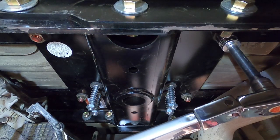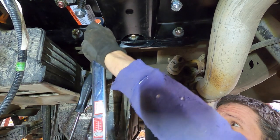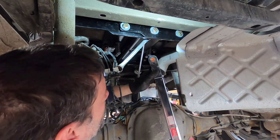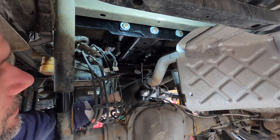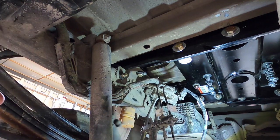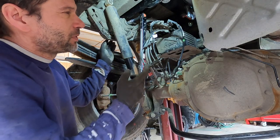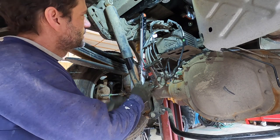Carriage bolts to 212 foot-pounds. And the 7 center section bolts are torqued to 212 foot-pounds. Torque these rail bolts, the 2 inside of the rail and 2 on the outside of the rail on both sides, to 150 foot-pounds. And the last 4 bolts to torque are the ones going through the truck frame rails to back up to 212 foot-pounds.